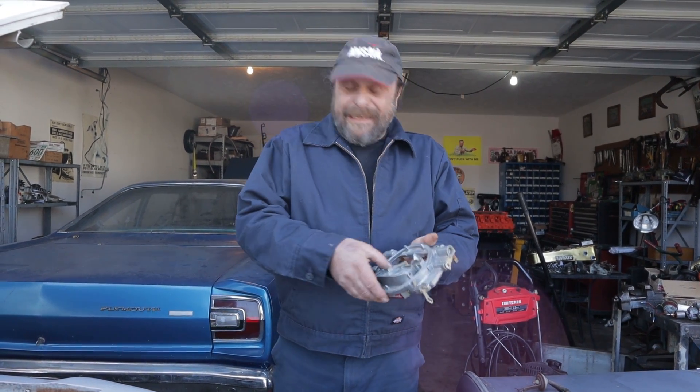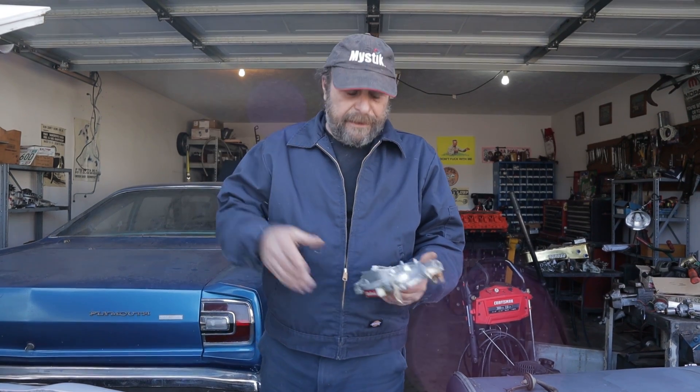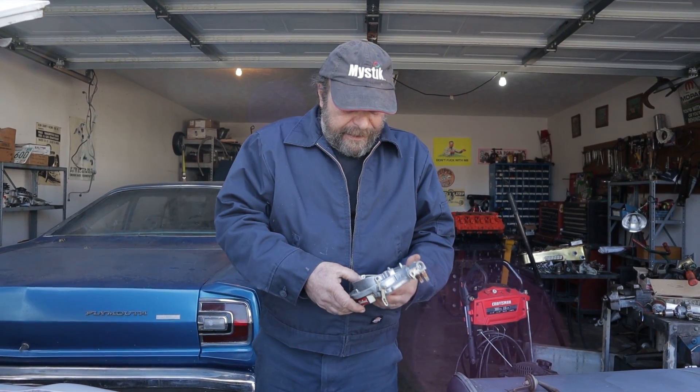For just a general overview, that's pretty much it. Now as a hot rodder, you have to ask yourself — do you really need one of these things? Most of my cars, anything that's modified, I don't bother with this at all. Two or three pumps, and then you've got to feather the throttle for the first 15 seconds — depending on the weather, if it's really cold, maybe 30 to 45 seconds. In the summertime, generally speaking, just a pump, click it and she goes. If you're restoring cars, then you've got to take all of these systems into consideration and deal with all the quirkiness. But for the most part, honestly, if you can — leave it off. Or do like God intended and put a mechanical choke on it. Just pull it out, as soon as it starts push it in halfway, and after it warms up push it in all the way. Hope you got something out of that. Next time we'll talk about some of the part throttle fuel metering systems — the Holley power valve, the drop rods, and the metering blocks. I'll see you tomorrow.